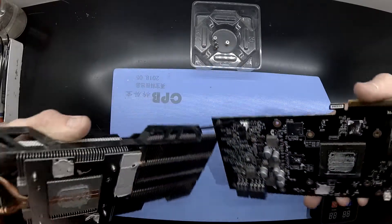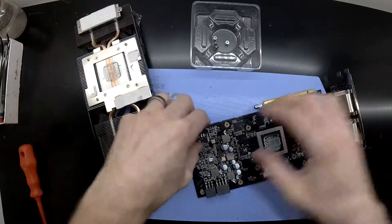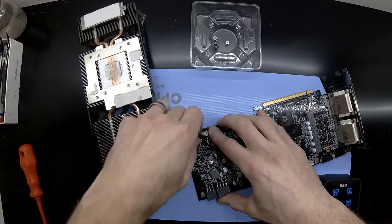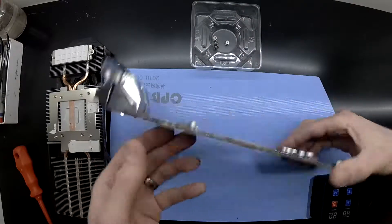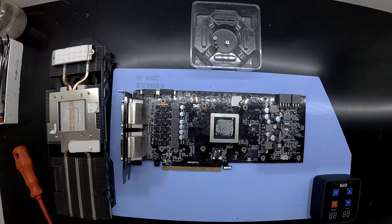The thermal paste will stick it down just a little bit. As you can see, we have the fans still attached, so you should be able to disconnect that relatively easily. The next thing from here will be giving the chip a clean with some isopropyl alcohol, and same with the copper cooler side of it.